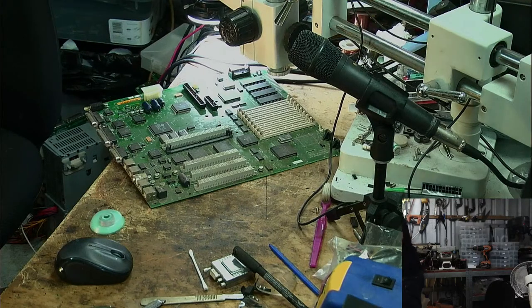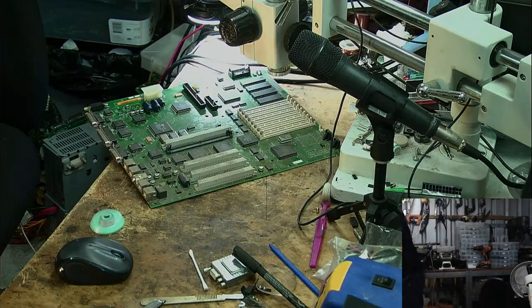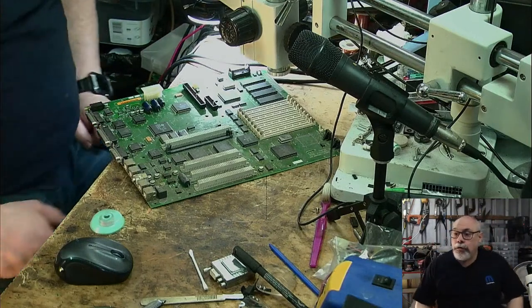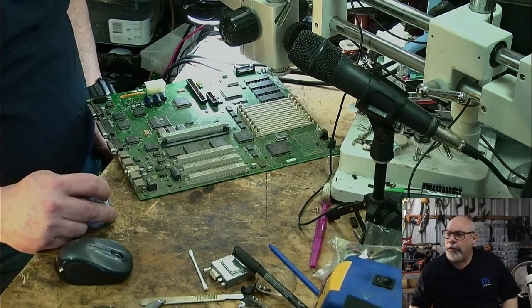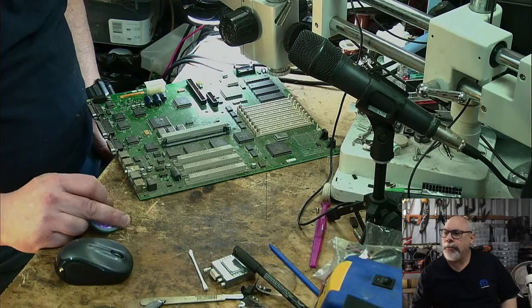Okay, different sound chip on the classic too, but the original classic, which I have one here, yes, same sound chip on the classic. So just so that you know, obviously you need two of them on this and there's only one on a classic. If you're ever in a situation where you need a sound chip and you've found an old dead classic board, you can use the sound chip off it. So yeah, this is definitely caked. Right, so let's just check and make sure I haven't missed anything.